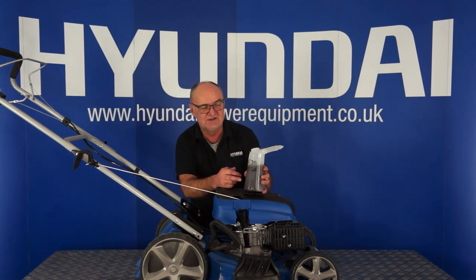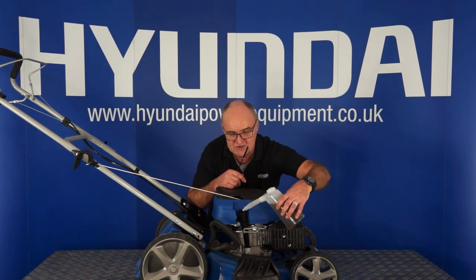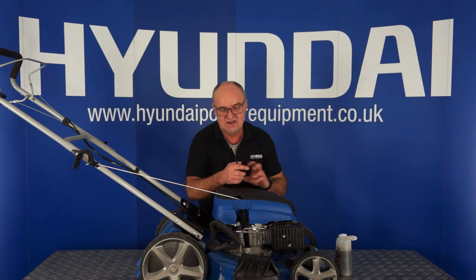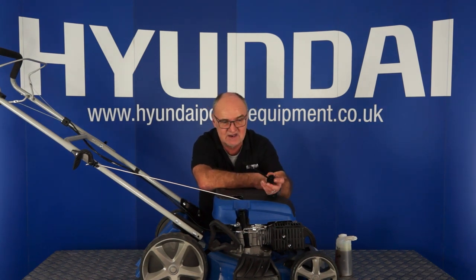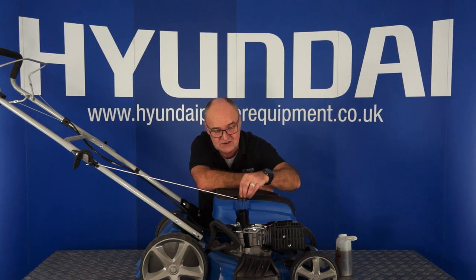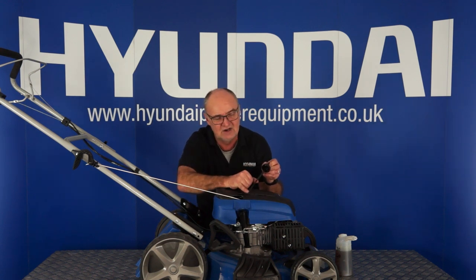You'll use either 10W30 or 15W40 engine oil, and you'll pour it in from a suitable jug or container down into this filler. Now, give the oil plenty of time to run out of the tube before you try measuring it with a dipstick, and go in gradually with your amount of engine oil. To test the depth, having waited for it all to flow down into the engine, simply put the dipstick down until it comes to a stop, pull it back out, and then read your oil level